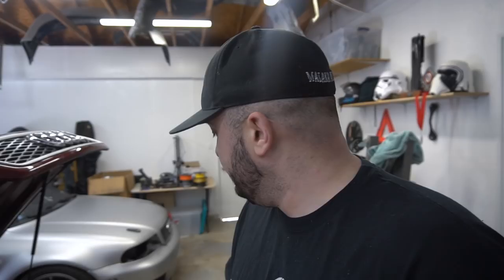This episode, we replaced the sandwich plate, had to run around with the fittings, had to figure stuff out for clearance issues we didn't anticipate having, especially when we were deleting that spacer. Actually, it doesn't sound bad for 2150cc injectors, six of them, and being the first startup base tune, it's pretty good.